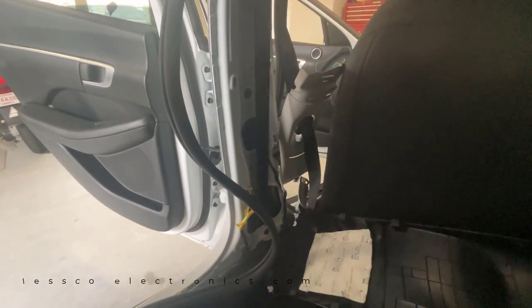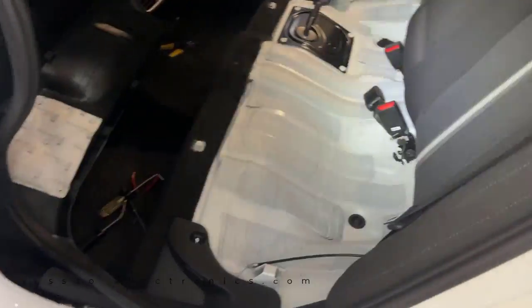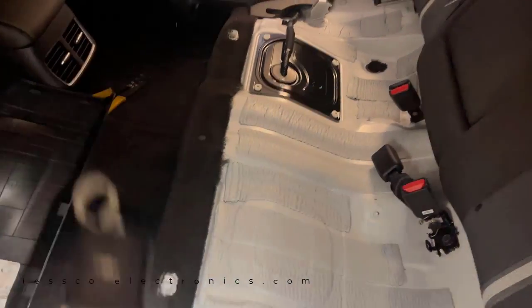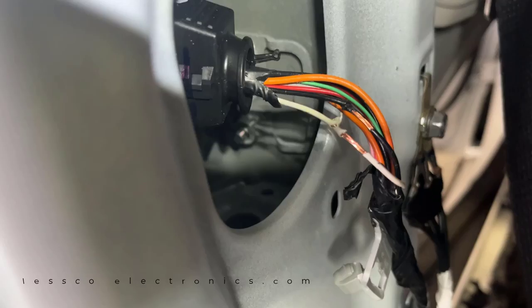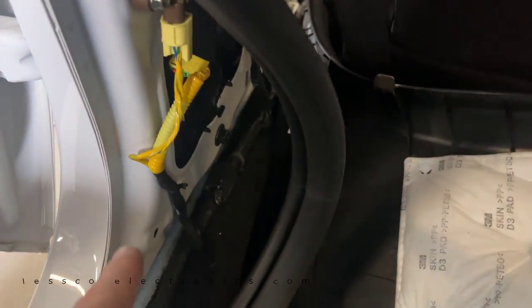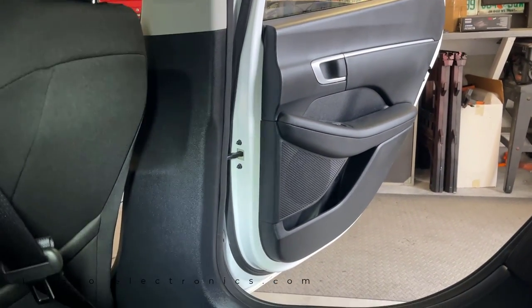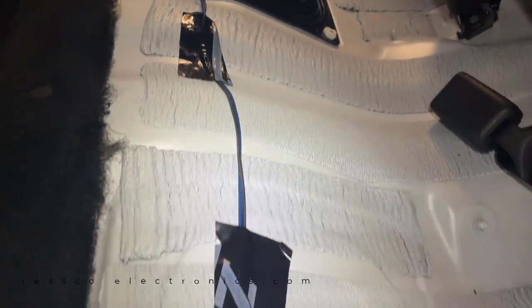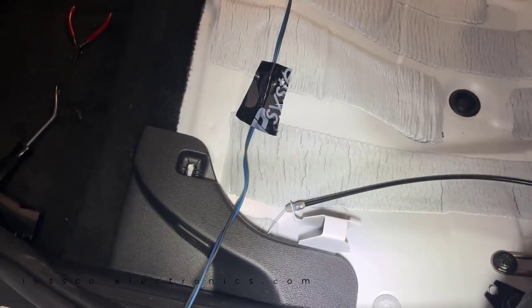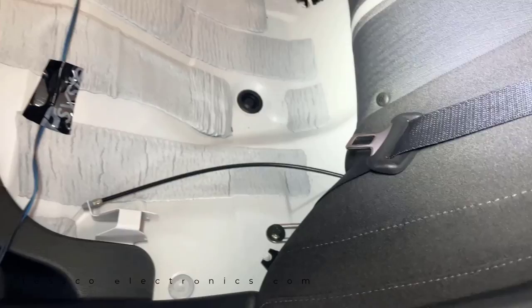This is what the left side looks like. I've got the back seat out - you just grab it here, pull it up, straight out - held in with prop clips. The left speaker wires on the Sonata were right there: black and white. The other side was brown and white. I'm going to run that passenger side down to the driver's side, running my power, remote turn-on lead, and two speaker levels into the trunk area. I'm joining the left and right speaker wires, running them under the seat, and into the trunk so we can start wiring the amplifier.